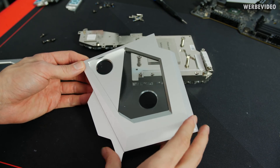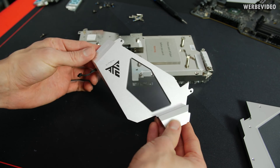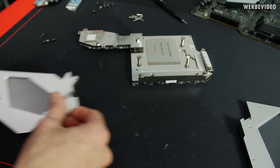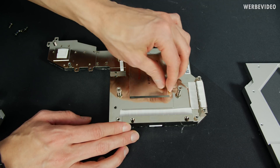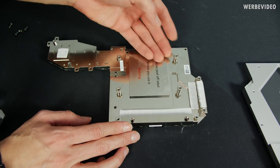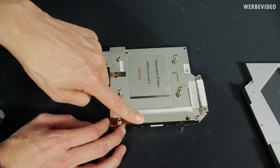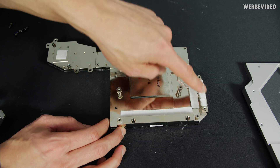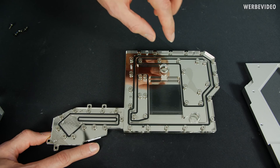I really like the quality feel of this board — it feels like a full metal part, like full CNC milled. There's a decent amount of aluminium, same goes for the bottom part with the engraving right here, and RGB lighting on the bottom feels quite nice. Looking at the water block: this part makes contact with the CPU. There's a label on here and I really hate those labels — it only leads to people forgetting to peel it off. This part here makes contact with the MOSFETs and the power stages. I had to remove the thermal pad that was sitting right on top because we have some screws underneath, same goes for this area — also for power stages and inductors on those two areas.